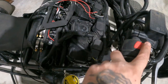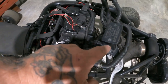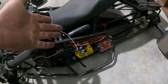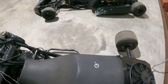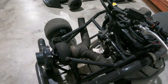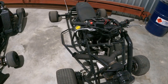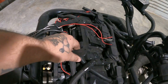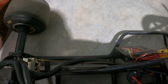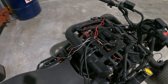This is not going to have as many inputs and outputs as this other one. We've got the start button, ignition and start, so I don't need anything else. I'm probably not going to run the ignition switch as well - we'll see, because then it's another relay I don't really need. We've got the up and down gears, and this one's got no jacks on it, so I might put some jacks on a bit later. But yeah, this one here is going to be pretty sweet once she's hooked up on FuelTech. I also need to change up the display and remove the old EMS mount and old ECU mount down there - the FuelTech will go right there in the center.